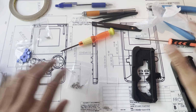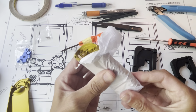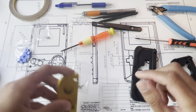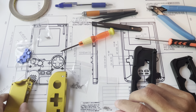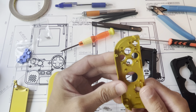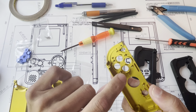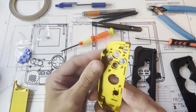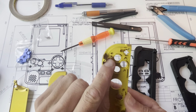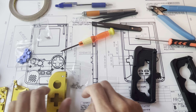Since I'm on that topic, that is probably the biggest risk, the thing to pay attention to: stripping fasteners, stripping the heads, stripping the threads, or getting a fastener stuck in a hole. In order to prevent that, the first thing I do is look at your parts. Sometimes they put plugs in for anodizing. You'll see a white plug, it'll be really obvious, plugging up the hole. So look at all your holes.